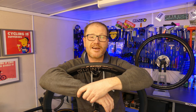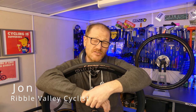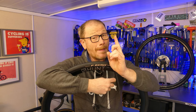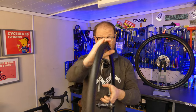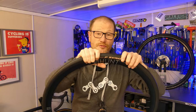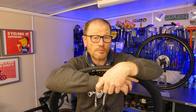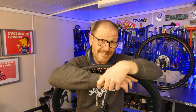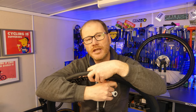When it comes to mountain bikes I think tubeless is great and it works pretty well on gravel too, but road bikes I think the jury's still out. Yes you do get less of your typical common punctures but super hard increased tire pressures, delicate narrow tires with fragile sidewalls does mean that you start to get the sort of problems that you wouldn't necessarily get with chunky tubeless or even inner tubes.